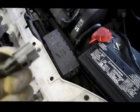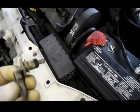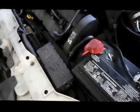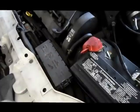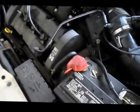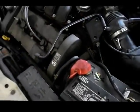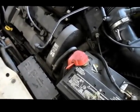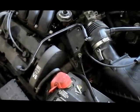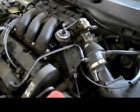It's just hard to believe that a cooling sensor could cause this to happen with an engine. There's a saying that you could be as old as a cow and you learn something new every day — this is a new one to me. That's definitely what the problem was. I've had this thing running for a good half hour now: shut it off, start it up, drop it in gear, drive it around, and it seems to be okay. Anybody else running into this problem, keep in mind that's the sensor right down in there. Check it out, and if you have a scanner and can see the actual engine temperature, check the temperature and see. If it's happened to anybody else, let me know — I'd be curious to hear if anybody had similar issues. Thanks for watching, see you guys next time.